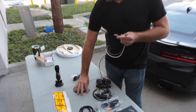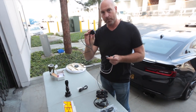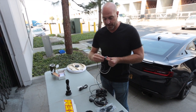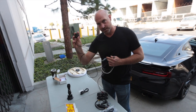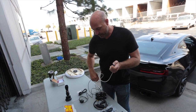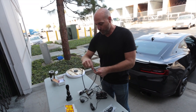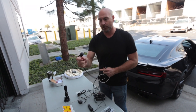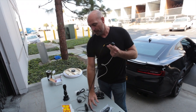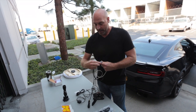For the OBD2 connection, we have a pass-through OBD2 plug and a 2-pin connector that goes into the CAN 2. We're going to install this into the OBD2 port on the ZL1. And then for power, because we want to be able to take this in and out, we make a 12-volt cigarette lighter style adapter harness, and that has a 4-pin connector that connects to AEM net.